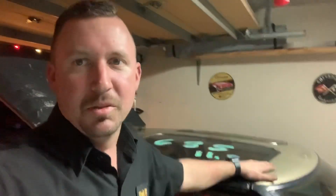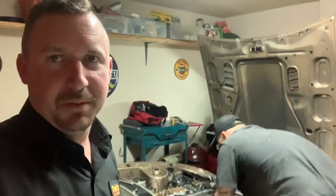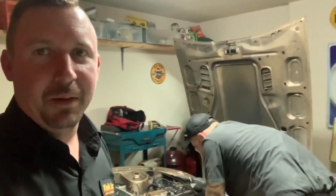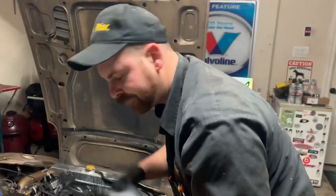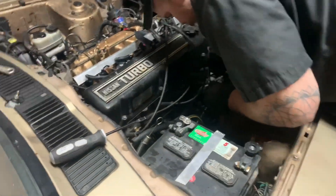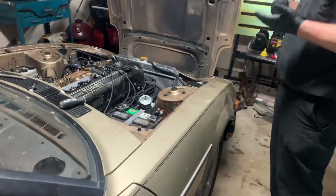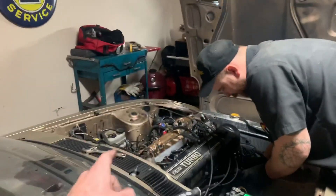All right, so Friday night this week we're going through the fuel system. Car moves, transmission shifts good, everything looks pretty good. Now we're making our changes to the fuel system. We got Matt working up here getting the hoses and fuel filter and stuff out. We got a new fitting to go on the fuel rail, a new fuel filter to support three-eighths inlet and outlet, and a pressure sensor that'll go up there as well.